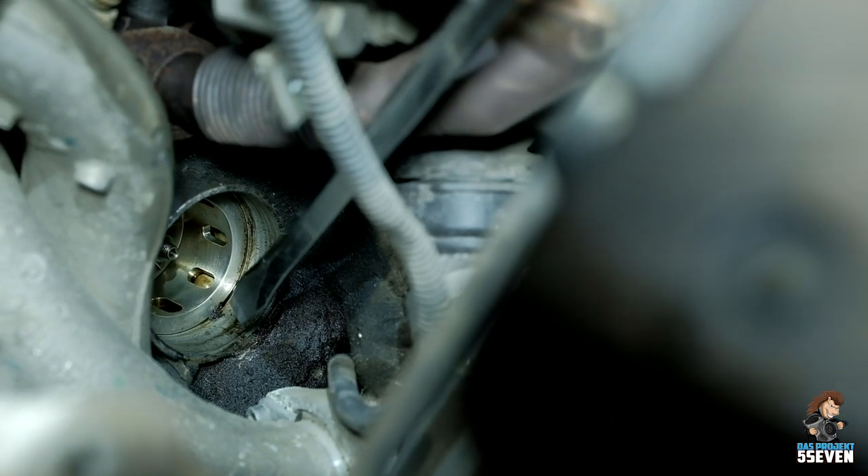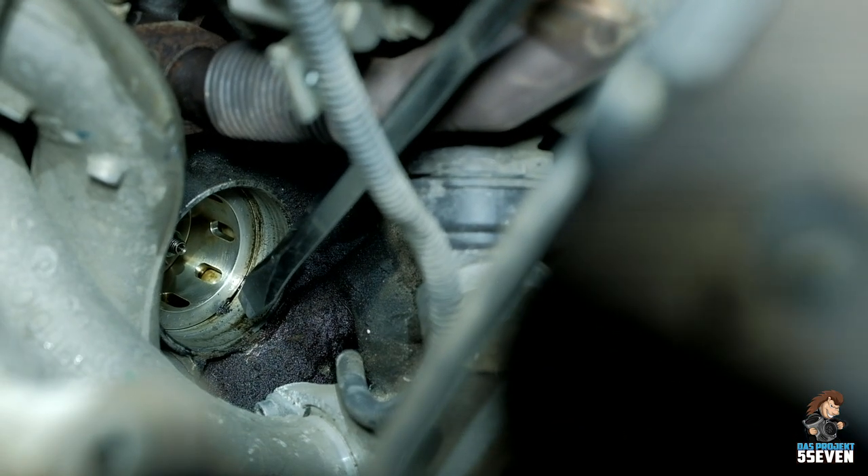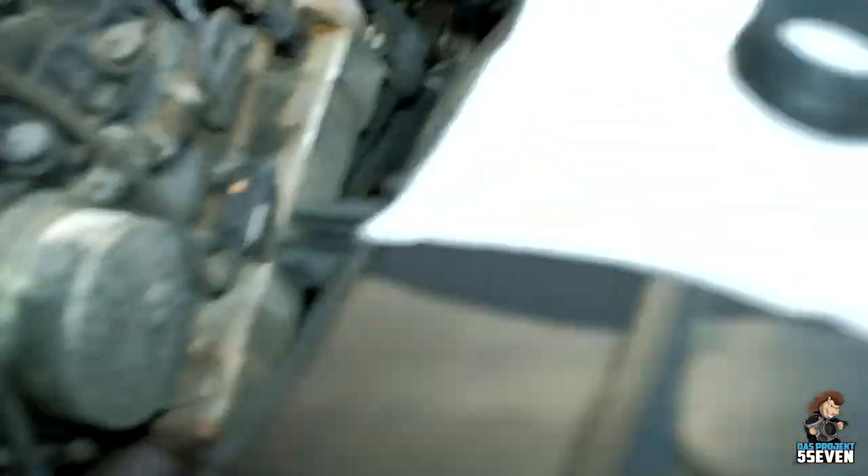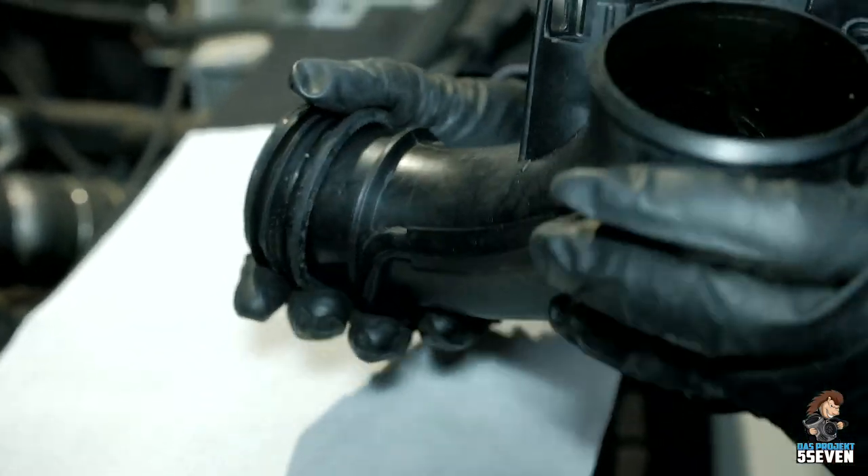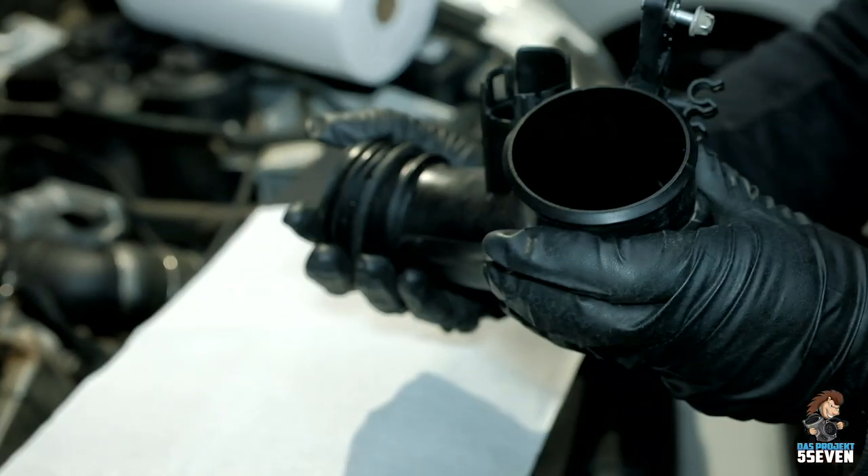You can see that there's a lot of oil leaking, and that's basically a symptom of a failing gasket. This is the gasket that goes on this pipe, which comes from the air cleaner — so this one's failing.